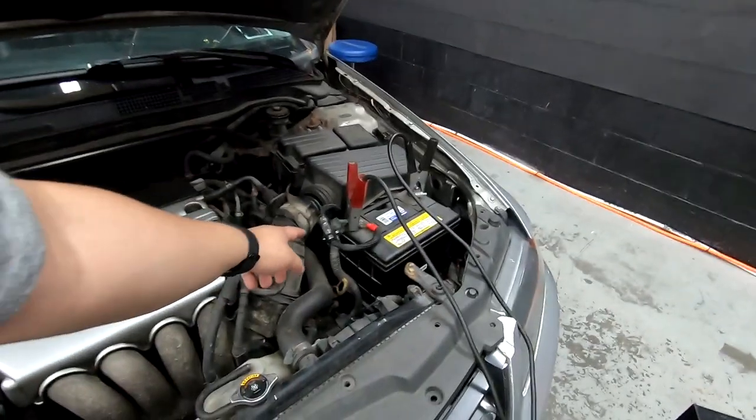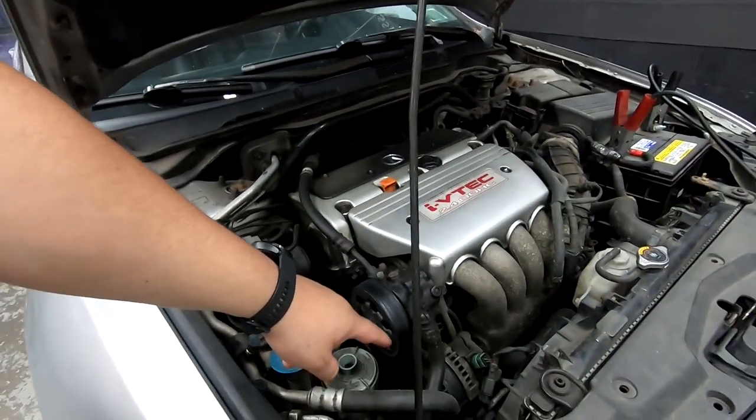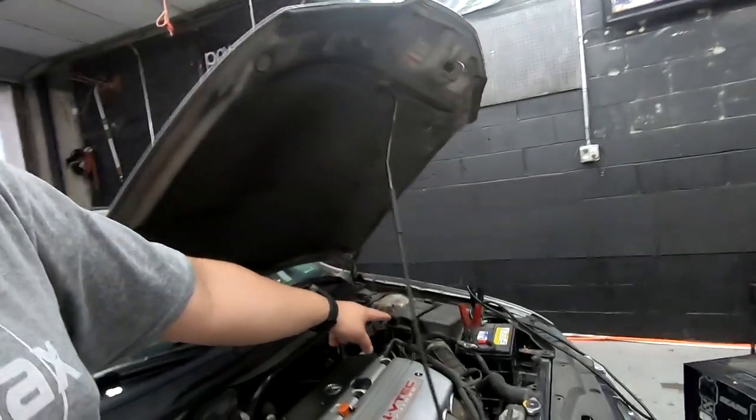Also, when it comes to power, I mentioned this in the subwoofer video, I'm gonna mention it again. This has an 80 amp fuse up front. We have 2 40-amp fuses in the back. This is, I think, a 120 amp alternator. So we're using most of the alternator's power. The fuse up here shouldn't be more than your alternator, because you're gonna be starving your system for power. So just remember that. If you're doing a big system, keep that in mind. Second battery, upgraded alternator, big 3 upgrade will help you with that. That's really all I can think about issues.